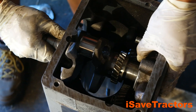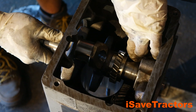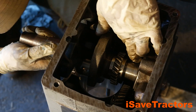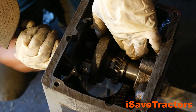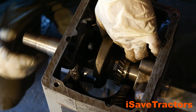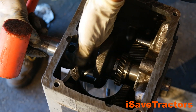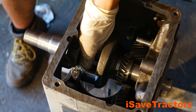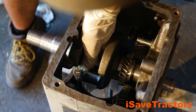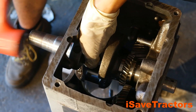Now this is where it gets a little tricky to capture on camera. First, we want to lubricate the bearing surface of the crankshaft before we install it into this engine. After we do that, we want to push the crankshaft in so the 12th tooth that we marked on the crankshaft gear with the black Sharpie lines up with that seventh land that we marked on the upper balance gear. Now this engine is in our engine stand, so everything is kind of upside down. The upper balance gear in this video is the one on the lower stub shaft — when this engine is turned right side up, it will be the higher balance gear. After I line that 12th tooth and the seventh land up, I'm going to gently tap the crankshaft into the gear so it just barely starts to mesh. I then look and confirm that my black Sharpie line is lined up with that silver line that I put in the balance gear.